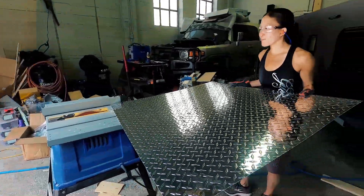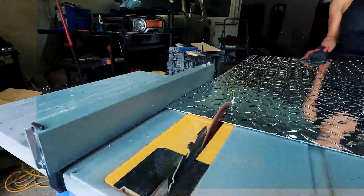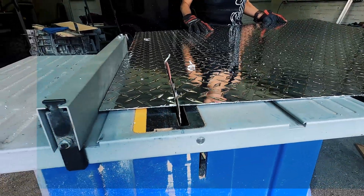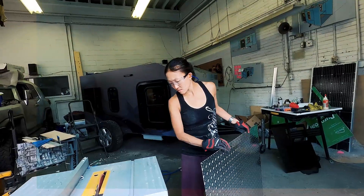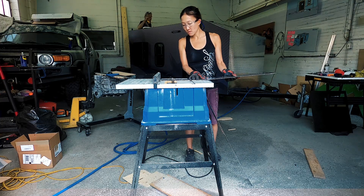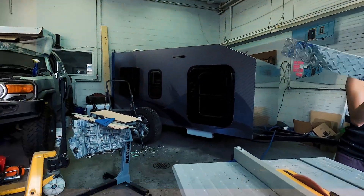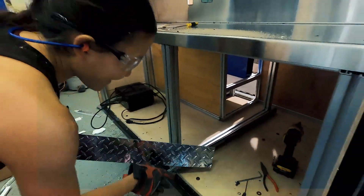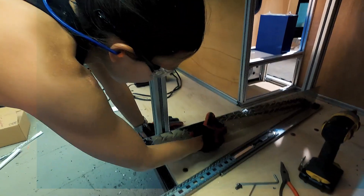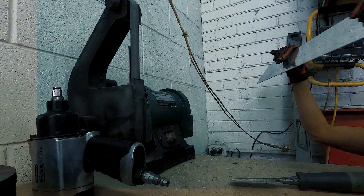The leftover checker plate — Jen had her eyes on that and decided she was going to make some brackets for the slide for the fridge. Here she's just ripping away on it with the table saw and she's getting quite confident with it. We purchased 150-pound bracket slides for the trailer to mount the fridge and to slide the fridge out to be able to access it. With the 8020 you can't adhere the slides directly to it, so we needed to create the brackets — that's what the checker plate was for. Here you can see Jen measuring up to figure out how to mount the checker plate to the 8020 and then the brackets to the checker plate.